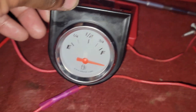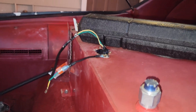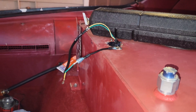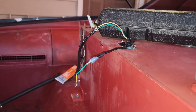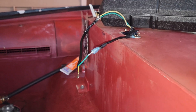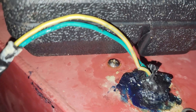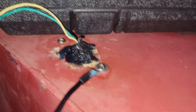Once you actually get power and ground to it, it floats all the way over. Also on your fuel cell — because I tried to look this up and it was kind of hard finding it — YouTube videos that show the wiring from a fuel cell didn't say which one is ground and which one is the signal. The green wire is ground. So these screws right here are both ground. I just took the green wire and ran it right here on the fuel cell itself.